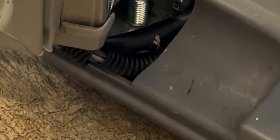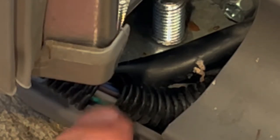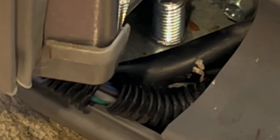If we get a close-up shot of this, you can see these wires that come through this tube. You want to check these to see if any of them are broken, because of the way that this door opens and closes. There's not a lot of slack in these wires and they're going to be prone to breaking. When they break and these connections are lost, that's where you're going to encounter problems with your ice maker, with the control panel, and even other functions of the refrigerator. Also make sure that your water tube, which is behind these wires, isn't pinched, because that could affect the amount of flow you're getting in your water dispenser. These wires do have different colors representing different functions of where they are routed.